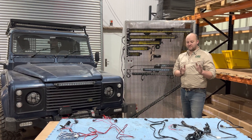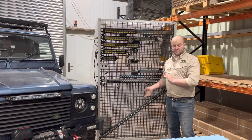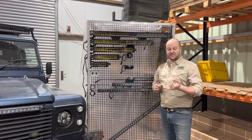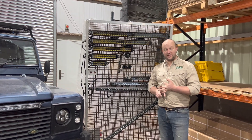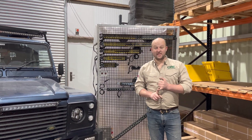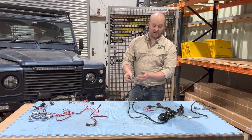Harnesses — lots of questions about harnesses. Easiest way to sum this up: all the lights, bar the TRX's, use a DT1, DT2, or a harness starting PC06 to PC17. The TRX range only uses harnesses ATP1 and ATP2, and that's to do with the plugs on the ends of the harnesses.